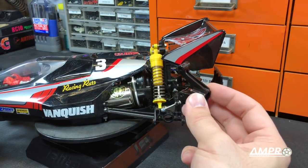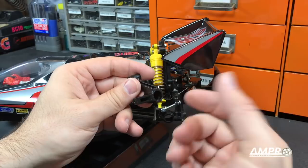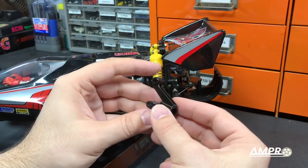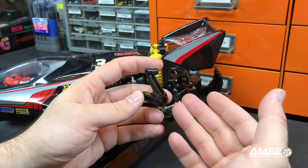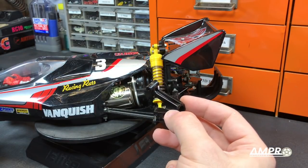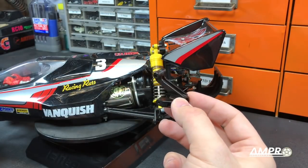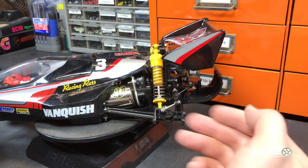The reason for this is the hub is made out of a very hard material. This is good to keep geometry consistent when going over rough terrain, but it is not good for wear and tear. Stress on these can often result in cracks. Anybody that has a Tamiya Hotshot can attest to this. Usually manufacturers will get around having something very rigid by using different materials. Team Associated used nylon for their suspension. This makes the suspension very rigid. Unfortunately, it also makes it more susceptible to breakage.